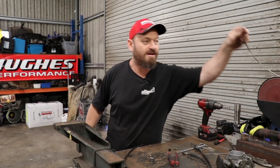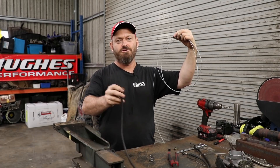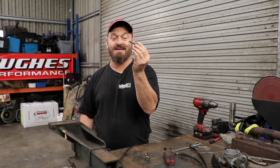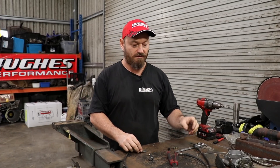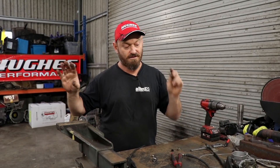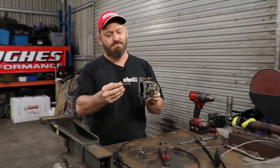You can buy the outer by the meter — one meter, two meters, whatever — and you can also buy the inner. Motorbike shops commonly stock teflon-lined cable for throttles and clutches. The problem then is anchor points — you can buy new ones, but I prefer using OEM parts because they've got dust seals, adjusters, and if that's what your firewall requires, you need to reuse it anyway. So what we've got to do is get our anchor points and attach them to the throttle body.